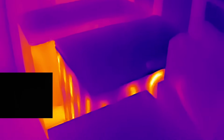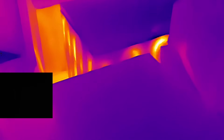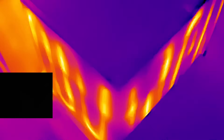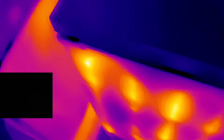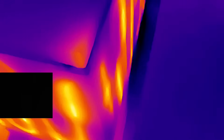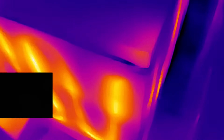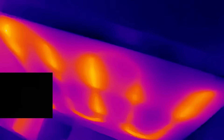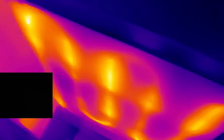We made it out to the shed. It's pretty amazing what you can see with the thermal camera that you can't see on the regular camera — you can see all the tubes going back and forth in the condenser. Knowing this information is important because out here I've made sure to keep some distance between the freezers to allow airflow to pass in between so they can effectively operate. The nice thing about condensers located in the side of units like this is you don't really have to clean them the same way as a dedicated condenser.